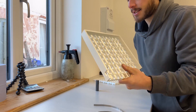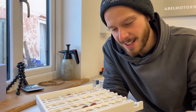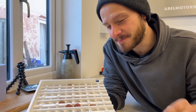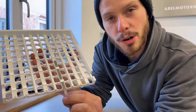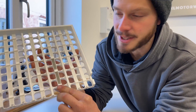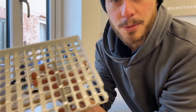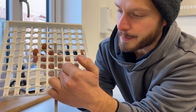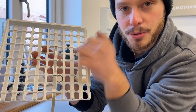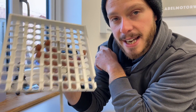I've designed into this cell package a fused link system. I don't know if it's going to work, so that's something I'm going to do today. Instead of the nickel plate being directly mounted to each top of the cell, it is going to run inside these channels. The battery will be next to it and we will spot weld a fuse link between the cell and the nickel strip. This means every single cell will be individually fused.